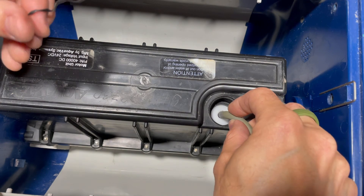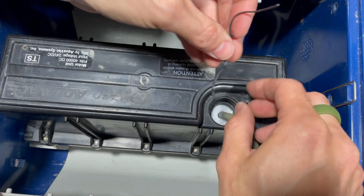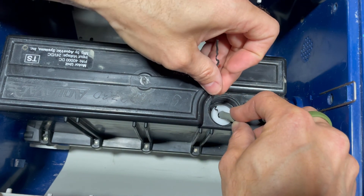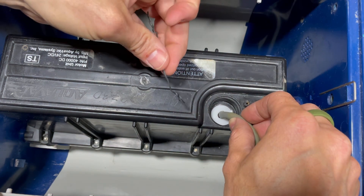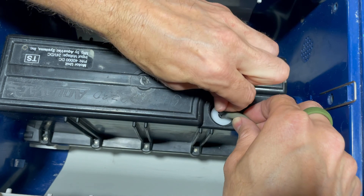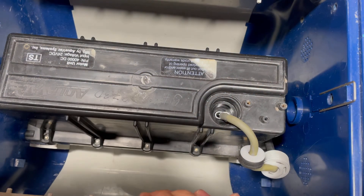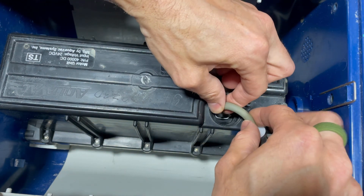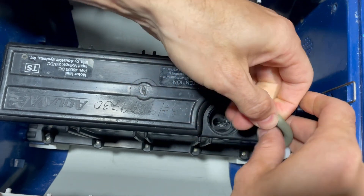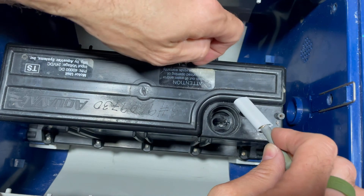Underneath here you have another plastic spacer. At this point you can just pull the wire and it will come up with it because there's a plug. Or if you want to be delicate with it, there's a little bit of space if you move it to the side. I find if you sort of screw it in there you can pull it. Under here you have the plug so you can just pull it — wiggle it back and forth as you pull. It only goes in one way because there's a little notch and a tab, so you can't put it in the wrong way.